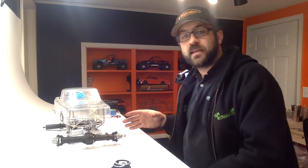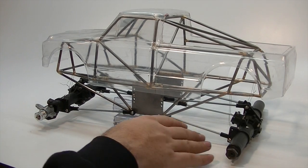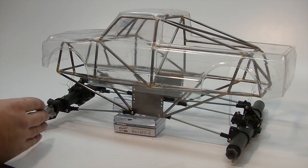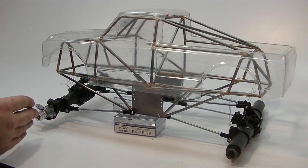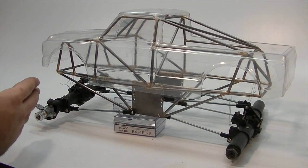I'm going to run some big power and we're just going to see what it can do. After doing this mock-up, I've decided that I'm probably going to grow the wheelbase about three-quarters to an inch. The majority of that wheelbase will be added in the rear, with just a quarter inch added in the front — mostly to get my shock angles in the right position. The shock angles are mostly important to me for aesthetics; I want them to match up with the shock hoops the best they can. The actual tires and wheels won't necessarily match up with the fender wells on this body, but in the full-size Megatruck world that rarely happens.